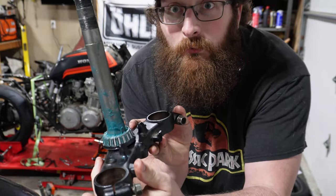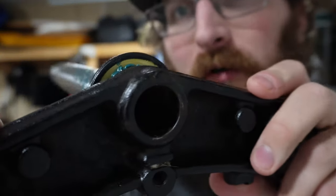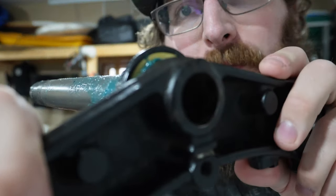We're going to bring it inside and press the steering stem off. When I went to press this out, I took a close look at it just to make sure I wasn't missing anything, and sure enough I was. The bottom of the Superhawk ones have the steering stem safety welded in. So I'm going to have to grind that safety weld out before I press out the steering stem. The good news is I'm pretty sure the one made by Cognito is aluminum, so we won't have to safety weld it back in. It'll be a press fit.